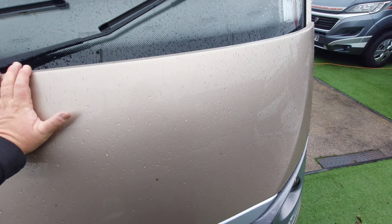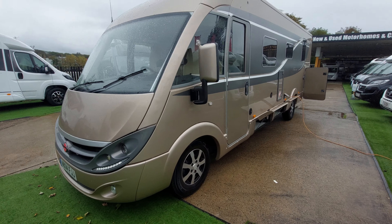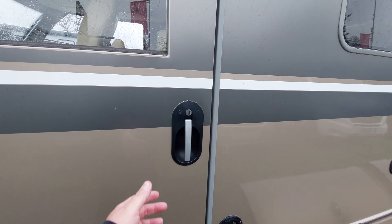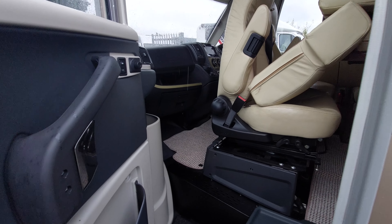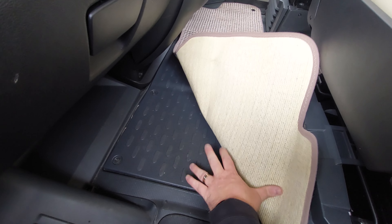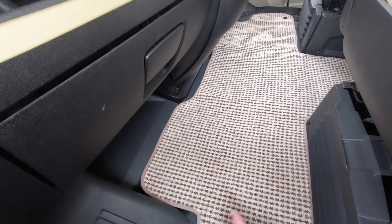With any A-Class you'll find it easier if you're trying to open or jumpstart the vehicle to go to the battery, which is between the seats. If I open the passenger door, it's located underneath the flooring area under the mats — that's where you'll find the engine battery. The bonnet release lever is hidden in this little corner here, just up there.